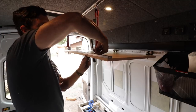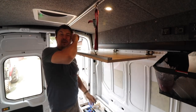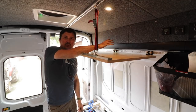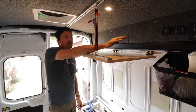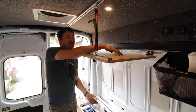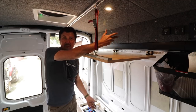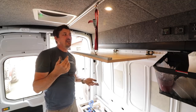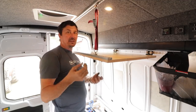Here's a little different perspective on how this is going to work. What I found for race car netting, I needed something that was 12 inches tall, this is a little bit more than that, 12 inches tall and 8 feet long. And it just so happens that there's a company making these nets that go over wheelie bars to keep the parachute for dragsters out of the wheelie bar. That's perfect. They're 24 inches, or 48 inches long by 12 inches, and it's really good high quality netting.